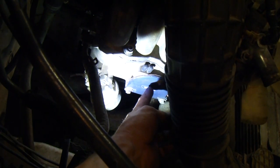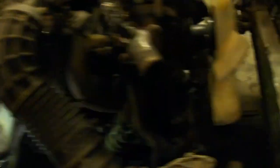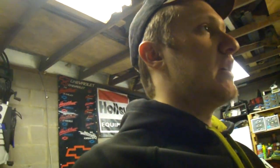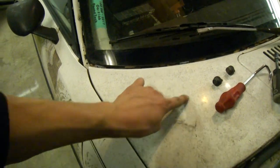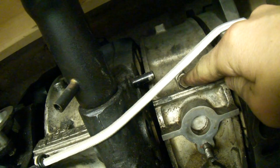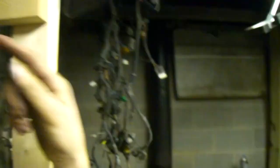You will need to block off the BAC plate and the two vacuum ports there. This car does not run the factory OMP. If you're going to retain the oil metering pump, the Rats Nest has an oil metering pump distribution finger — imagine one vacuum line in to four vacuum lines coming off that, each going to your oil metering injectors. You'll have to delete those. There are plugs in the housings you will need to plug. This little hole right here is where the oil metering pump squirter goes in — you will need to block that off. Life hack: if you have an automatic car laying around, a flex plate to converter bolt will fit and it's the perfect length.